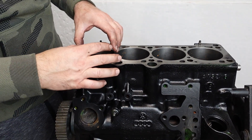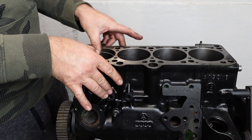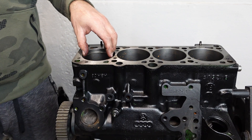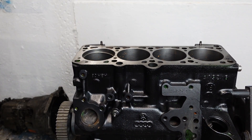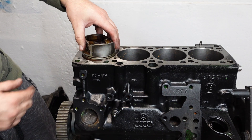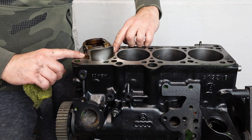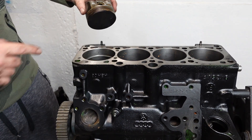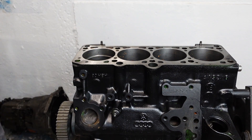Start off with piston one, ring one. Get the piston and put it in the bore - make sure you get it all even. Then we'll measure it with a feeler gauge and see what the gap is. It should be 0.3mm. If it's smaller, we have to open it up. I like to use an old piston to push the ring down, getting it as even as possible, making sure you've gone down about over an inch. Now get the feeler gauge out and measure the end gap.